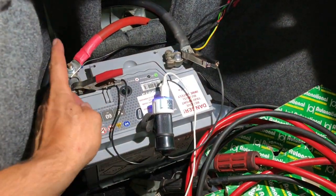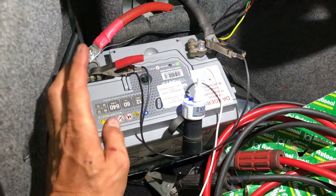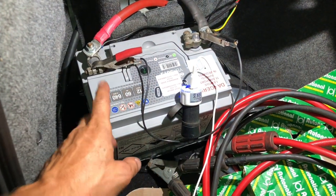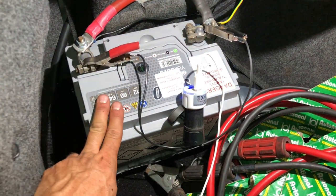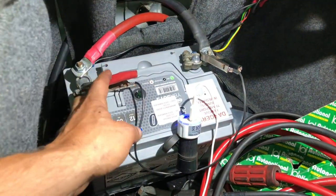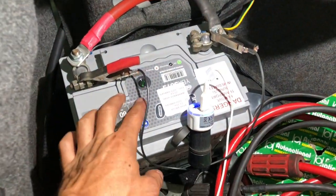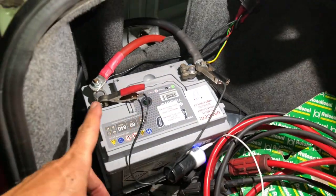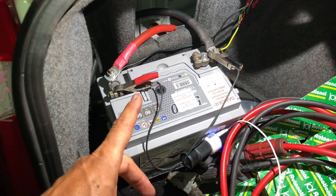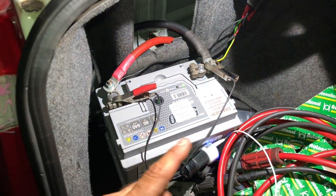Finally it's all come together - the giant battery cables, the earth and positive, this brand new 640 cranking amp battery, and the brand new starter motor. You can see how fast this car turns over now. Very happy - all that work has paid off. The car starts on the button now with no throttle input at all, which is actually not normal for this car. If you've got an Evo starting up slowly with battery and starting problems, change the power cables, change the battery, and change the starter motor.